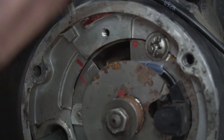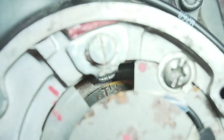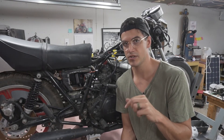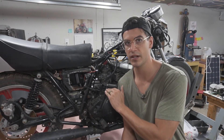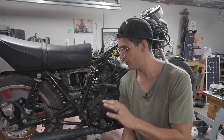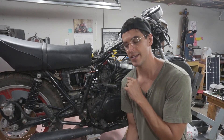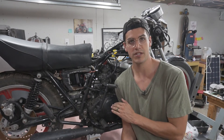So I pulled the marker off. I cleaned it up a little bit because it was a little corroded and it was kind of tough to see where the line was. Put it back on — I made sure it lined up perfectly with that T mark. T for top. Top dead center. I rolled the engine over again just to make sure it was lined up perfectly, checked the dial indicator again making sure the piston is at top dead center, and then I looked for the alignment of the marks and they were aligned. So I can say confidently that this top dead center marker is at top dead center. Next time I work on this bike I'm going to be setting the timing as precisely as I can, and I want to make a more detailed video about that. So stick around for more motorcycle projects.